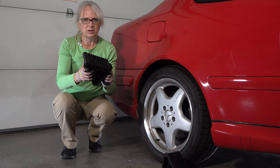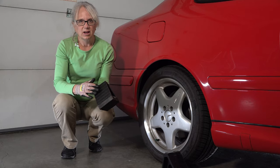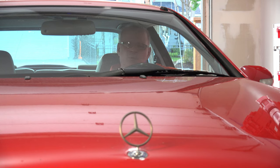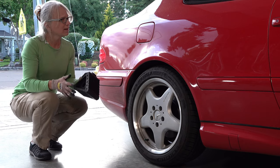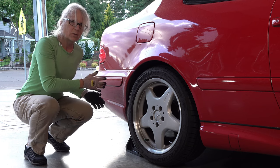The fourth problem is how to use the wheel chocks safely. Notice there's a handle, ridges on one side, and a flat end on the other. Do we place it with ridges up or with the flat side up? The car's in park and the emergency brake is on. Put one wheel chock behind the right wheel with the flat side down — just one, because we want to know if it can hold the whole load. For safety, I'll always chock from the side of the car and not the back where it can roll.